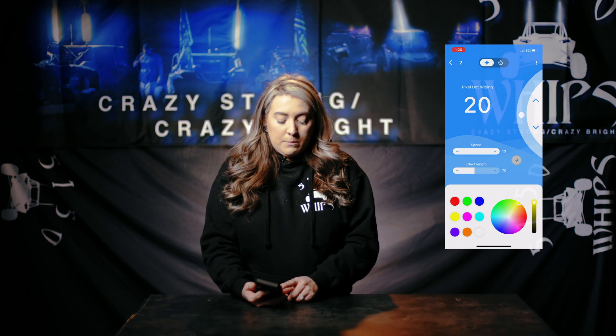Now that I've selected something — say solid color green that I want my rock lights to be on — I'm going to jump back over and go to channel two, which is where I can control my whips separately. So my rock lights can be on green and I want my whips to be on red, so I'll select red and now they're both separated. A lot of people like to utilize this function because going to certain areas on highways, you're not allowed to have rock lights running but you obviously want your whips running. This is where you can either shut products off — in this case the rock lights — or control them separately so that you're within certain law standards for colors you can or cannot run.